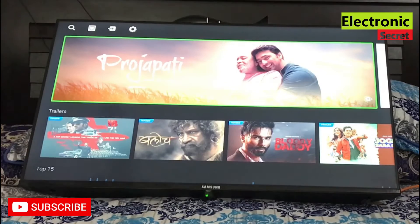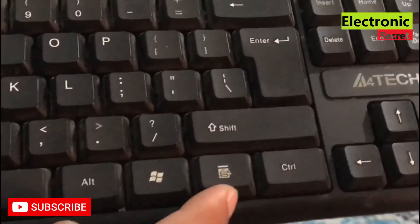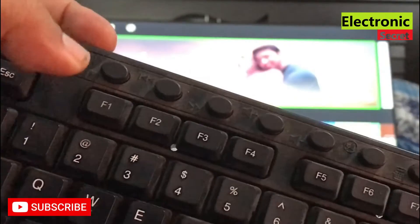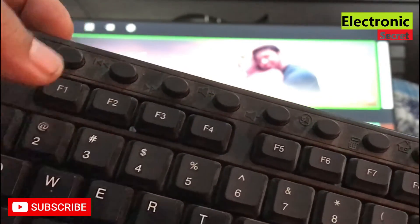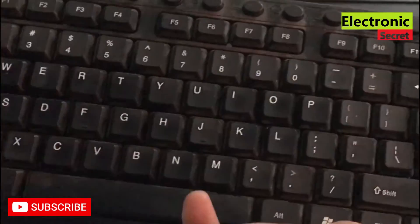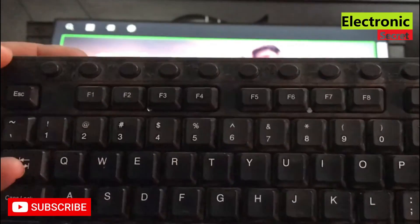For this TV's service menu code, I will press Menu and then 1147 from the keyboard. This is the Menu key that is along with the Windows key. The numbers on the right side with the arrow keys will not work — remember that. I will press Menu and then 1147 from the keyboard.